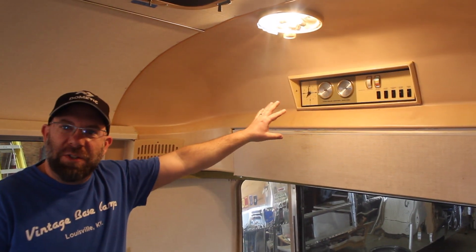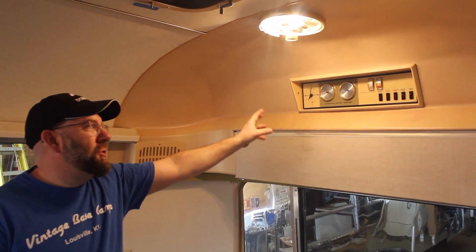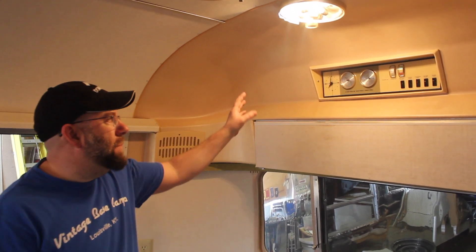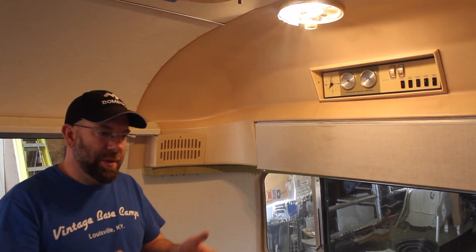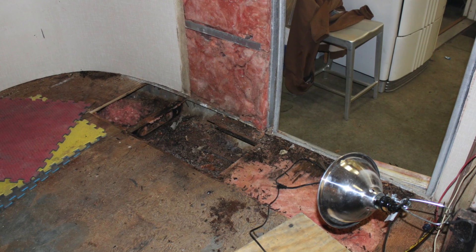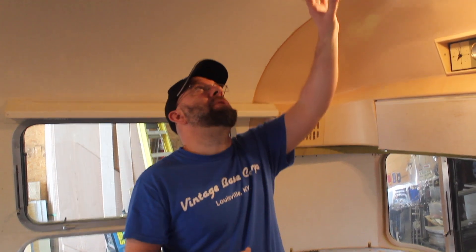The original control panel was so burnt up that it's essentially dead — which happens a lot. They did leave leads going to it so in the future there would at least be power and a fuse. All the electrical was moved to the back of the trailer. They replaced some switches, did a small amount of subfloor work near the door, and redid all the window thumb latches, screens, and bug felt.